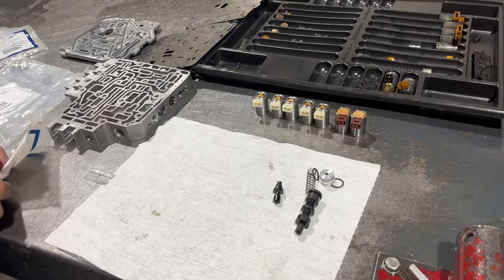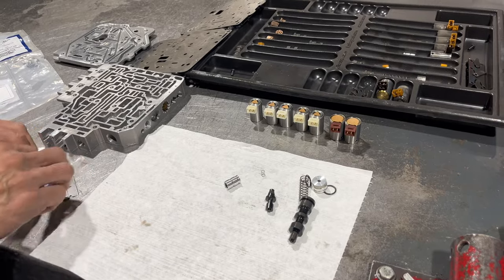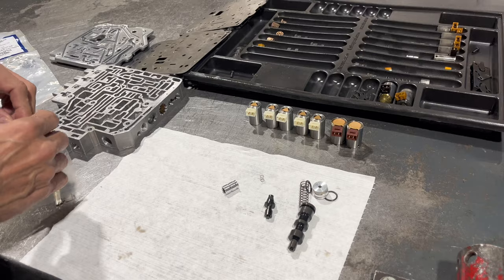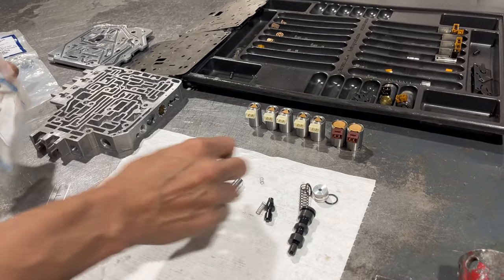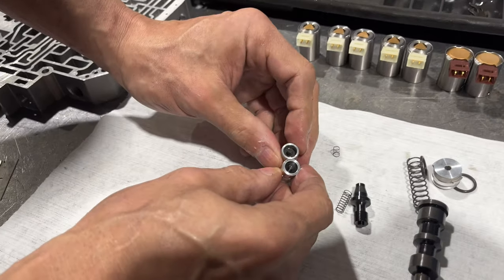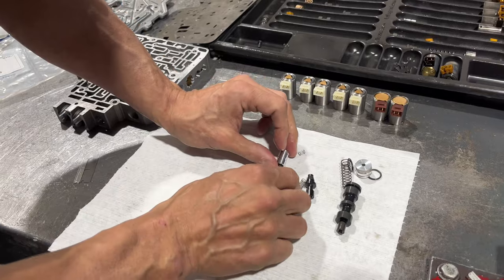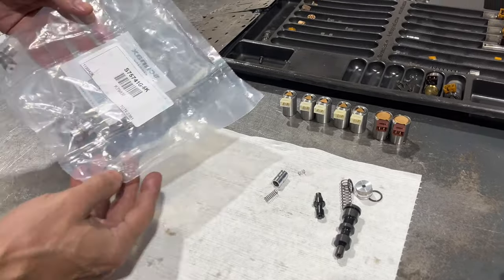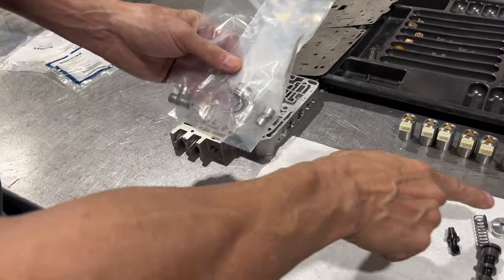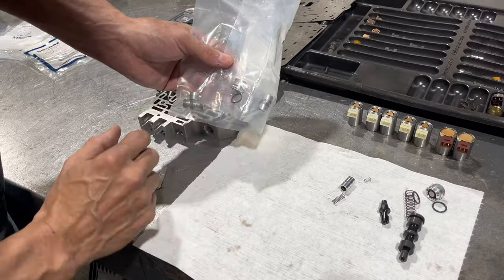Next, this is a source of many many complaints — this is a TCC boost valve, and it also comes with a spring. That makes your converter clutch application a little bit better. The valve is in there to replace this, which wears not only on the inside but on the outside — this whole thing moves around in the valve body and just pisses out all your lockup oil. These are just end plugs to replace the plastic ones where we can. They give you another pressure regulator plug but we don't need both — this end plug is different because we're boring the valve body oversized.